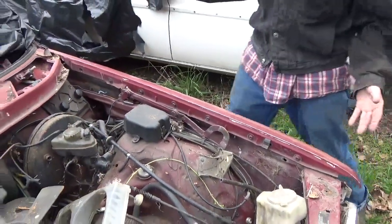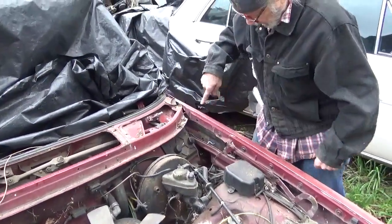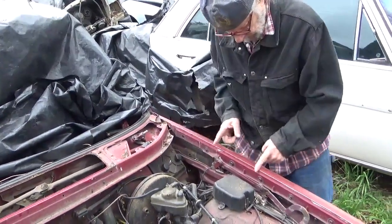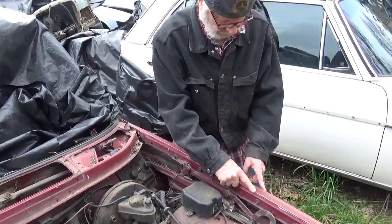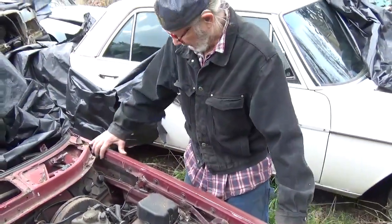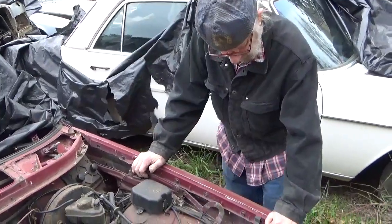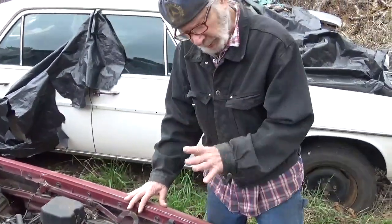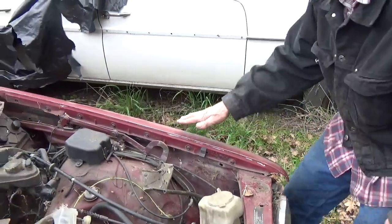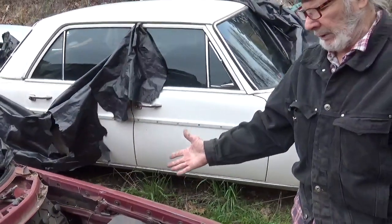Again, like a sardine can, you wind up the inner fender panel section by section. You don't have as much room because of the curve to get your fender ready. I've seen people try to do removals without doing this process — prying up here, prying back there — and all it does is warp your fender, and it's really no good anymore.